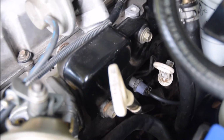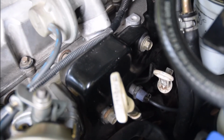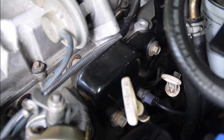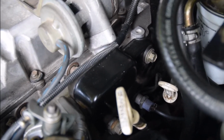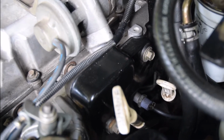So I'll pull out both of those dipsticks. It's just easy to get at. But the filter bolted into the block there is quite tight. It's hard to get at. So the best option, apparently, according to the Pajero forum threads, is to use a long shank 24mm socket.